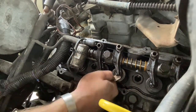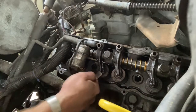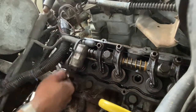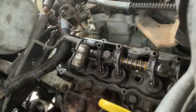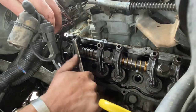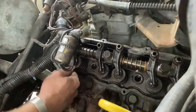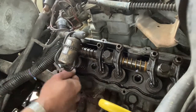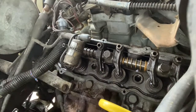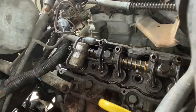As I turn that, you might hear the engine hissing - that's compression you can hear. That one - see, that's why you do this multiple times - that one's a little too loose. Come back around to cylinder number four exhaust - just a snug. I like that. Better, better, better. This one - I'm good with that. Quarter turn - I think two more quarter turns and we should be good. We are done.